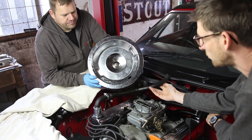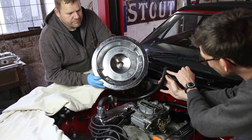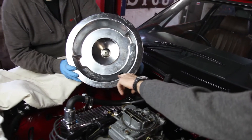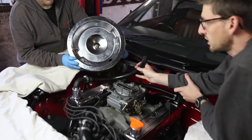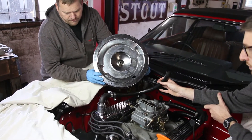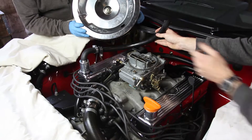The first thing we've discovered is the breather pipe here, which goes through into the air cleaner to scavenge any crankcase pressure. It hasn't really been fitted properly — you can see it's been working its way through the rubber here, so little bits of rubber will be getting into the engine. It's been chafing because it's just been fitted through an open hole in the air cleaner. When we supply our Weber kits, we supply the correct fitment that goes onto the preformed areas, which you drill out and the pipe can then clamp onto them.